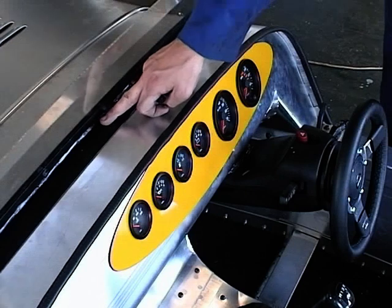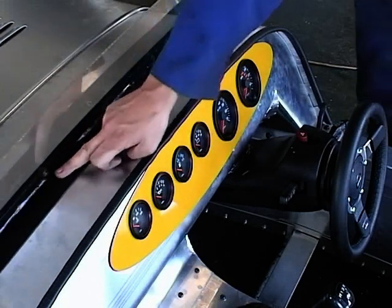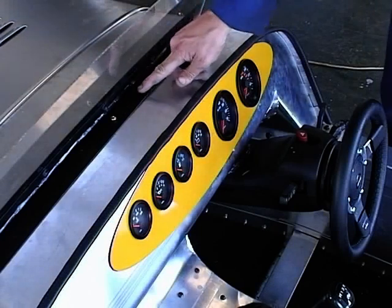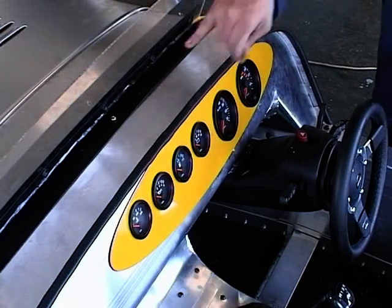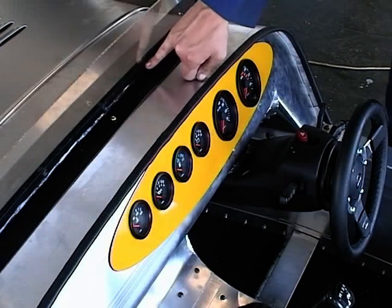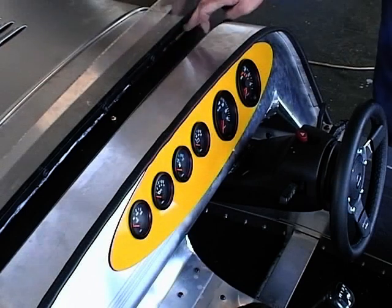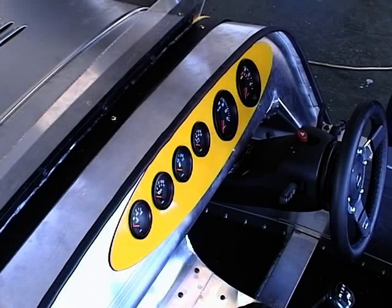I've also very carefully put some masking tape down the fly screen, and just run a very, very small bead of silicone in there, and just wet your finger and just gently, don't force it through the holes, just run your finger down there just to make it look a nice bead, and that will fill the cutouts that were in the back of the fly screen.